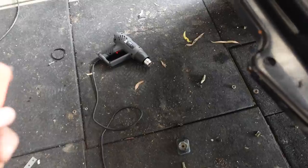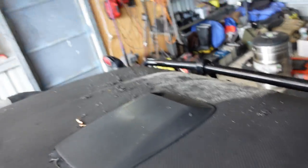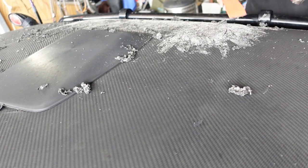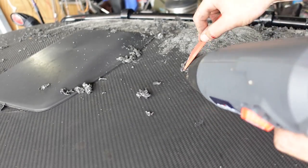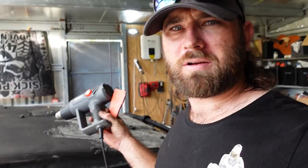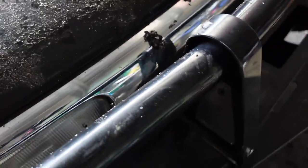I've started with the heat gun and this is how far I've gotten so far - it's not too hard, it's just very painfully slow. I'll set you guys up here and you can share the pain with me. Alright, that's enough making you guys suffer - I'm going to keep going and then we'll have a look when I'm done. There you have it, all that sticky stuff's off now. It's just a matter of going over it with wax and grease remover and getting all of that off.